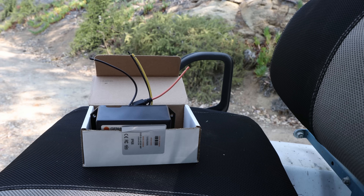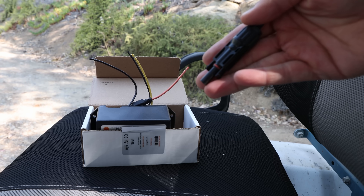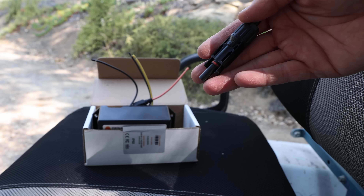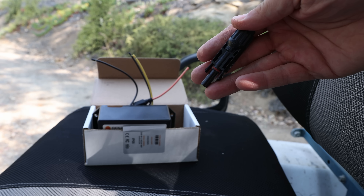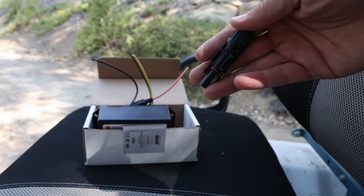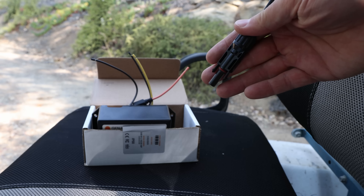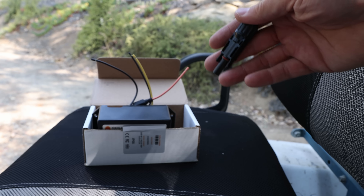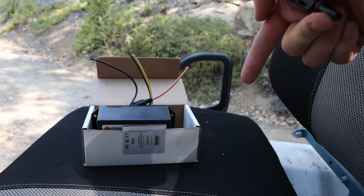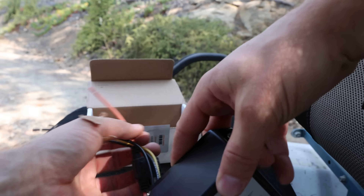You can make mistakes with MC4 connectors when you splice them — there are so many cheap ones out there, keep that in mind. If you want to go the route with MC4 connectors, totally up to you. You can also just do easy crimp and heat shrink connections — link in the description below for those as well. That's what I love to use with a heat gun, a little easy crimping, and you have a really good, sturdy connection. I need to extend the wire down to the battery compartment, so I'll be doing that now.